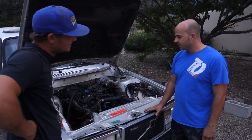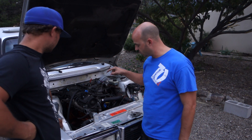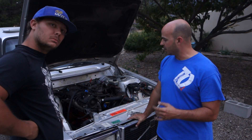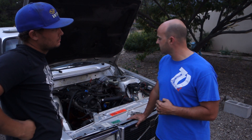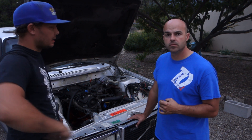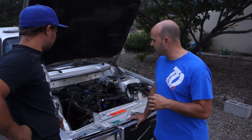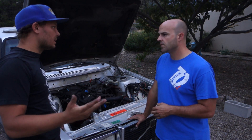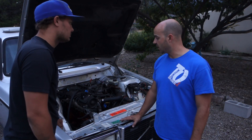There really isn't a whole lot left to do. We've got to put the intercooler on and pipe it up, put a turbo manifold on — which we're probably getting made by one of our fabricators in Sierra Vista or Tucson — put the turbo on, run the oil lines, finish wiring up the Megasquirt, basically run power to it, put the ground and hook everything up. We've got to get a bung for the intake air temperature sensor, get an exhaust made with a downpipe and a wideband bung, and probably bleed the brakes. Then we'll take it to stage zero after a shakedown drive.